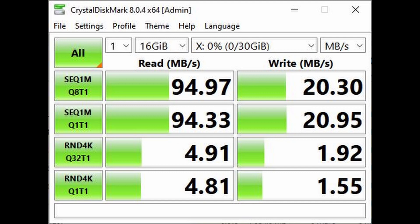The next two rows are the random reading and writing results, which are much slower. With memory cards this isn't really important because the camera writes data sequentially, so the sequential reading and writing results are much more important in my case. The reading and writing numbers from CrystalDiskMark are a little different from H2TestW because CrystalDiskMark tests the first 16 gigabytes while H2TestW tests the full memory card — that's where the difference comes from.